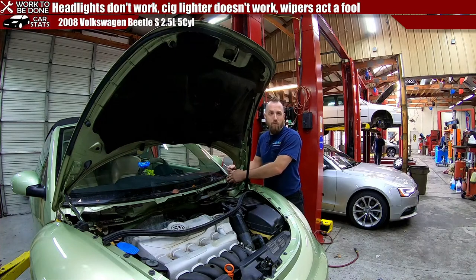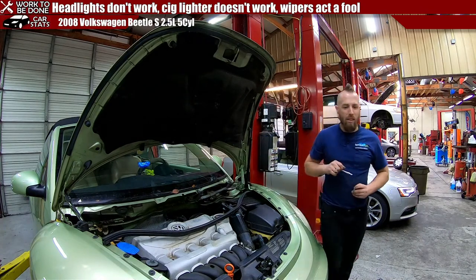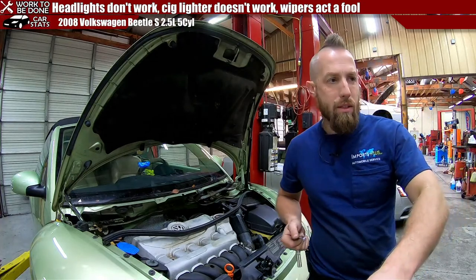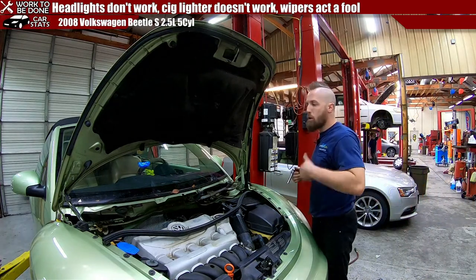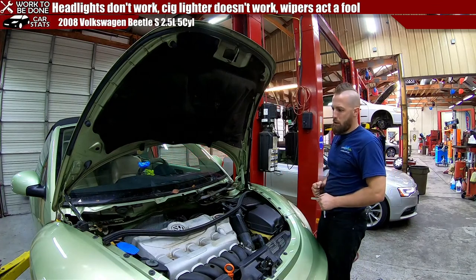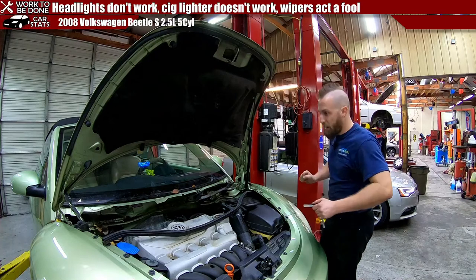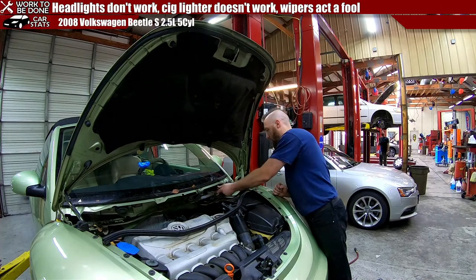Not necessarily uphill. And I wouldn't necessarily do full throttle. Even if you have a good clutch, you might stress it out. You want to put the clutch under stress, but you don't want to try and make it blow out. So pick a gear that's higher than what you're in and give it a little bit more gas where you know you'll be lugging the engine. So if I go to first, I go to second, and everything's cruising along, I put it in fifth and then give it some gas, and if it doesn't go anywhere, it's because you're lugging the engine and your clutch is doing okay. But if it just revs up, then your clutch isn't doing okay.